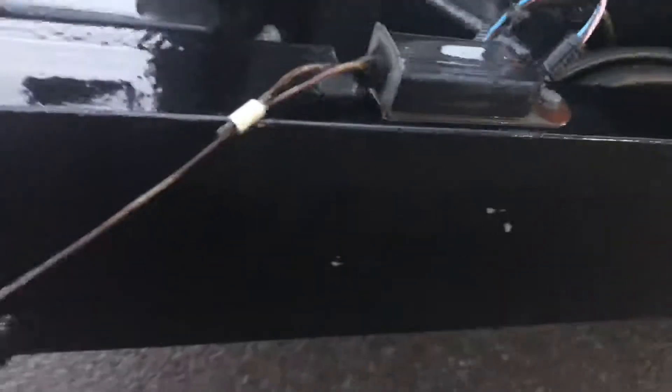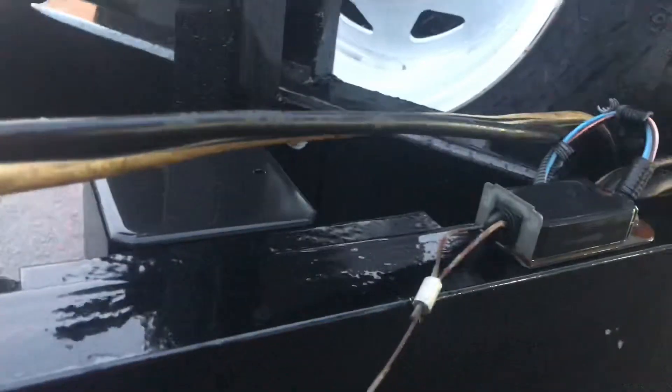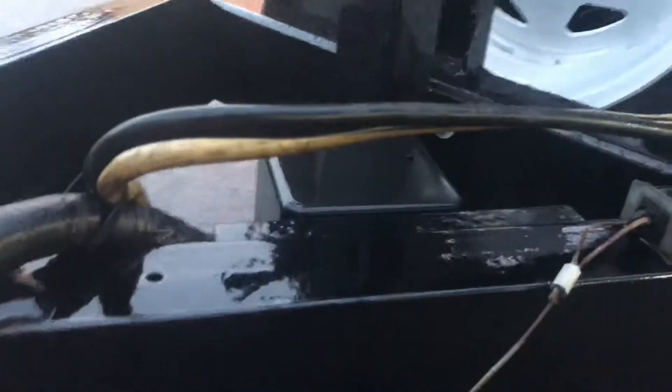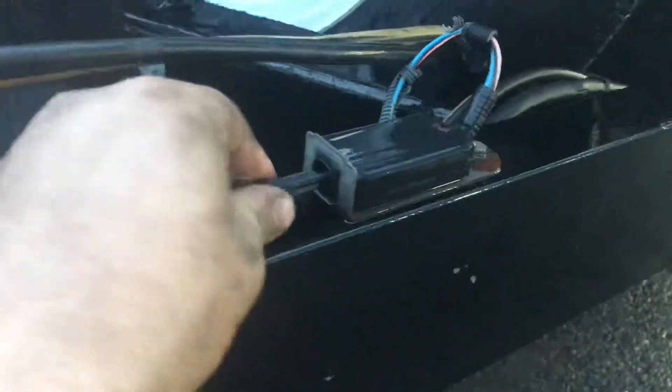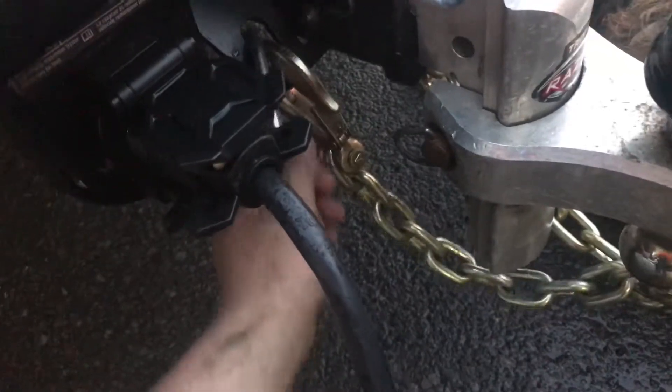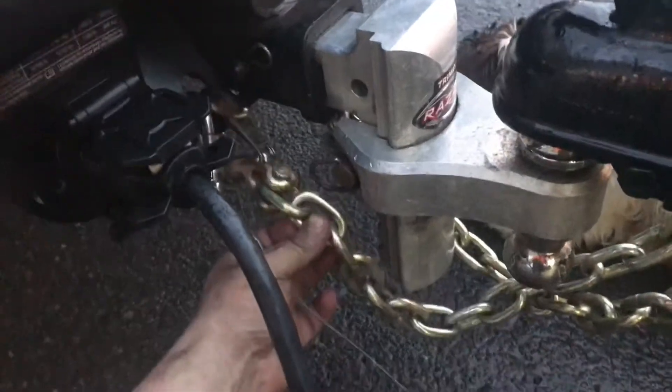Next is your emergency breakaway. This has got to be wired into a battery. If you've got a trailer with brakes, you've got to have that wired into its own battery — not the trailer battery for the winch or whatever you've got. When you pull this out, that puts 12 volts hot straight to the axles and locks the brakes up. It's not a parking brake, and it has to be hooked separate from your safety chain. You can't have it on the hitch — it's got to be hooked to the truck separate of the safety chain.